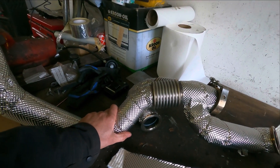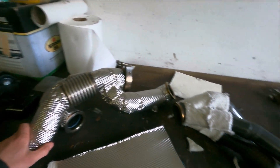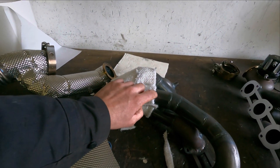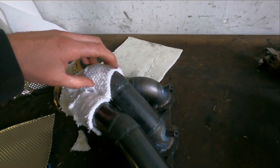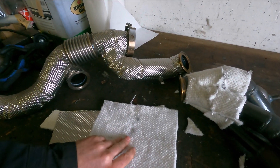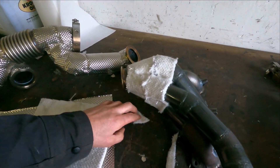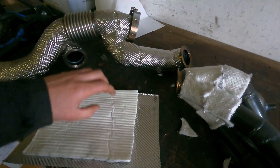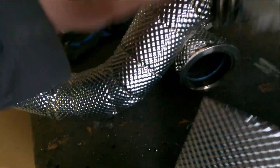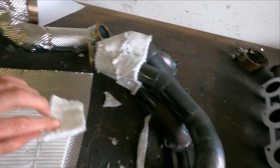What I did now - I got most of the exhaust done. I only have to do the exhaust manifold. You can see here I put the insulation on it. That's like five millimeters thick - it's like a ceramic wool. It's stitched, and on the back side there is a sticky piece, just like a sticker. You put it on where you want it.